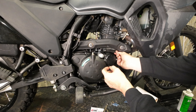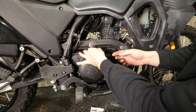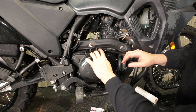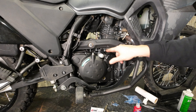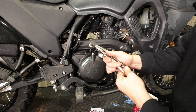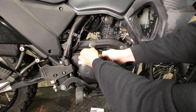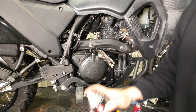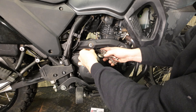So we've got the new cable guide in. We're going to put the clutch cable back through and put the jam nut in here, leaving the nuts loose because we'll have to adjust the cable location. The one at the front — spin it all the way in for now, then slide it ahead and take your needle nose vice grips to grab the cable and pull it out as far as you can. Give it a little squeeze, spray with the silicone again, and slide it on.